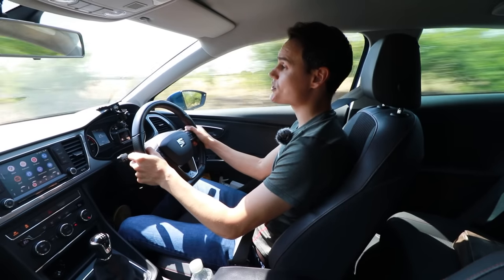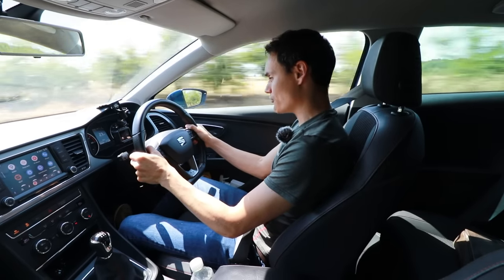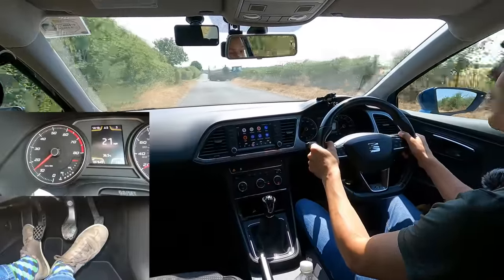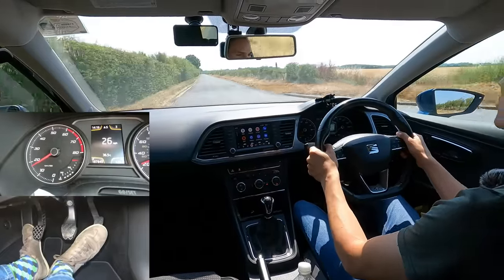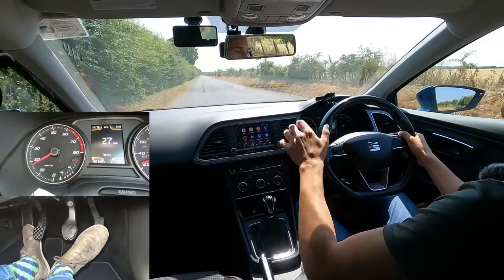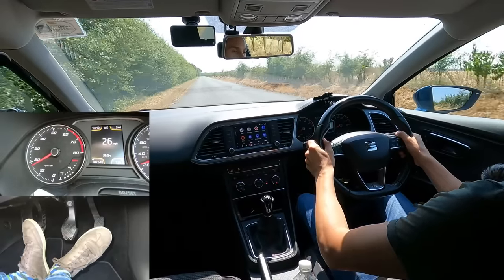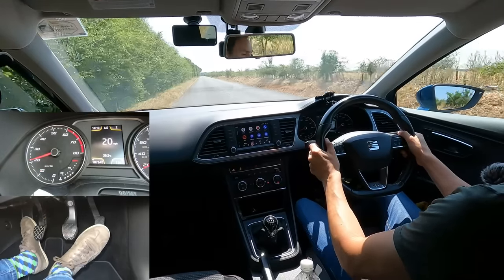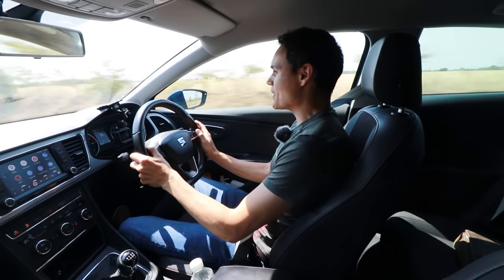The first method is the most basic and probably the one you're taught when learning to drive. It may be a little bit jerky because the clutch isn't going to have enough time to bring the revs up to exactly where they need to be. I'm in third gear doing around about 30 miles an hour and I want to go down to second. So off the gas, clutch down into second, bring the clutch up slowly. There's a little bit of a kick there - it worked, but it could be a lot smoother.